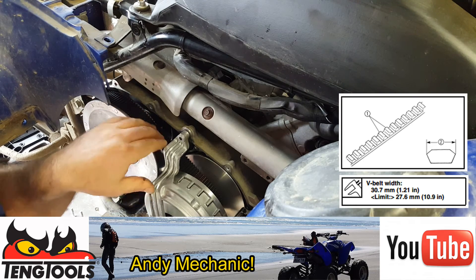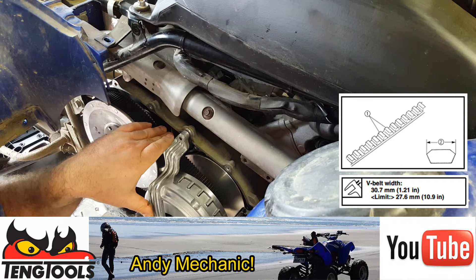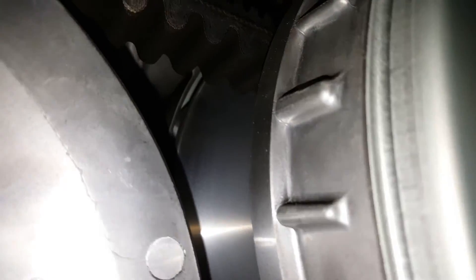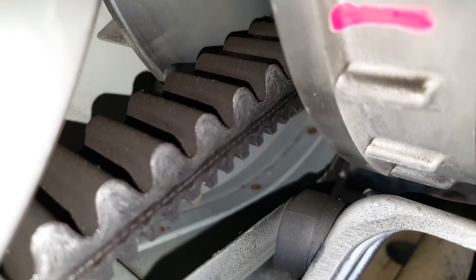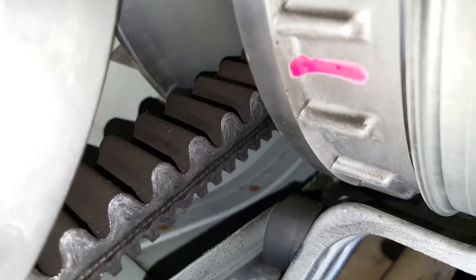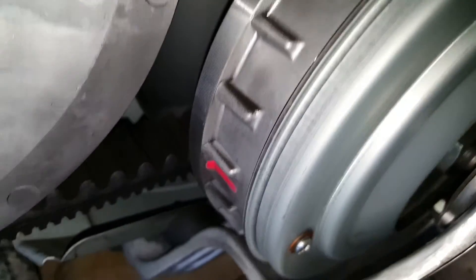So by the time it gets to about 600 to 650 hours, it's going to need a new belt. Now the other thing we're checking for on this belt is cracks and so on. I'm not going to be taking the belt off. Usually it's a good indication that if we're going to get cracks, we're going to get them pretty much all the way around the belt. You can also rotate the belt if you want, just to check all the bits and pieces. But there really is no need to remove the belt from the bike.